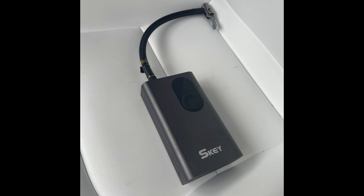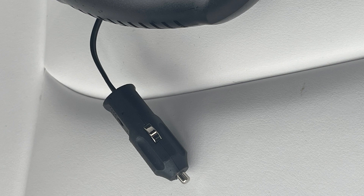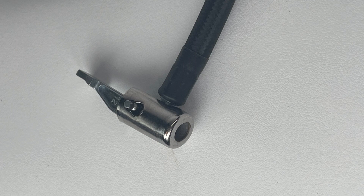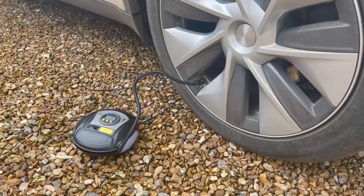Before we go, a quick word on the different types of tire inflators. You can get battery-powered ones — they're portable, easy to move around, and great for topping up pressures by a small amount, but they're not ideal if you have a big blowout and need a lot of air. Alternatively, there are types that plug into the cigarette socket — these will run all day long, though they're less convenient as you always have to plug them into the glovebox accessory power. Also look out for ones with a screw-in fitting for the valve, as these are much easier to use than clip-on types, which put a lot of pressure on the valve when you close them.